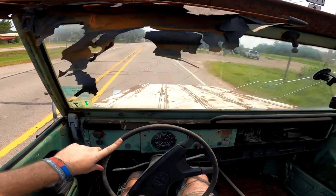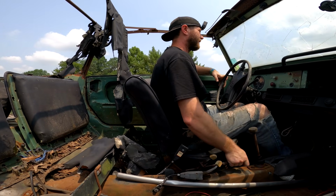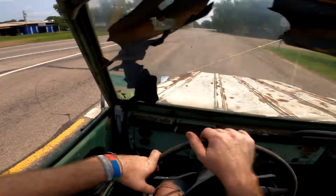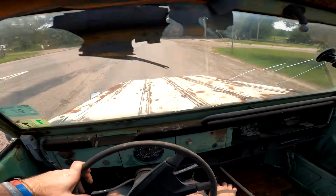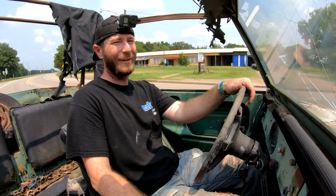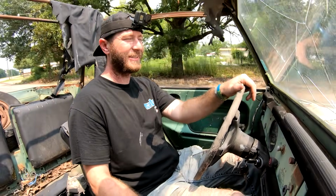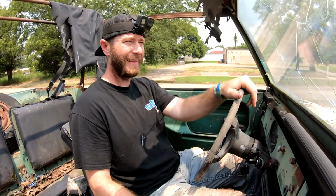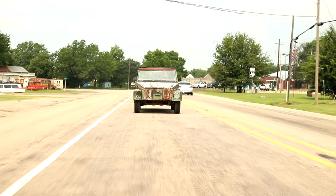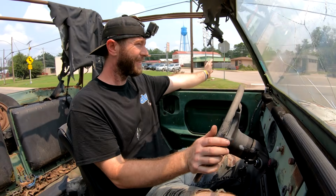Try to take it downtown just a little bit. I am trying to hit the brake pedal. Sometimes it doesn't want to idle, but I can baby the gas pedal and keep it running. Got to remember, this Super Beetle engine had been sitting up for 30 years, so I'm quite impressed. Just cleaning the points up and a new set of plugs that were in the trunk of the Super Beetle. Don't have any lights, blinkers, or anything like that, so use some hand signals.